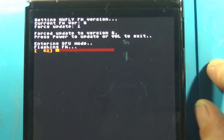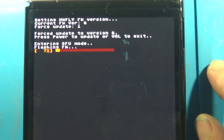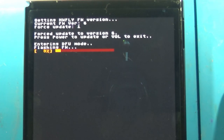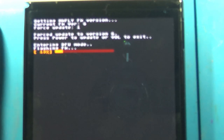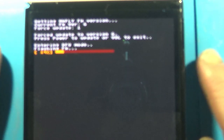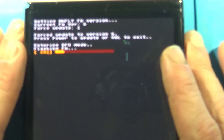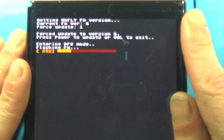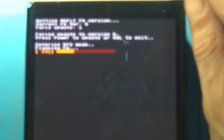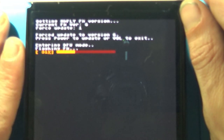You will not be able to get into this mode if you are using a Switch Lite, like with an SX Lite installed. That's being worked on. I'm trying to figure it out. Or say you have an OLED chip installed in an SX Lite, for whatever reason this isn't working in Switch Lites. So if you have a Switch Lite, you're going to need to update via the debug port. If you're totally cool updating via the debug port, you can do that instead of this.